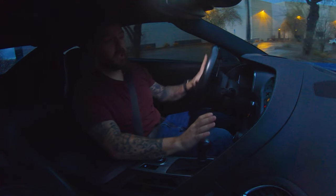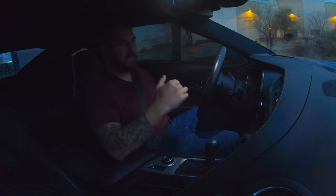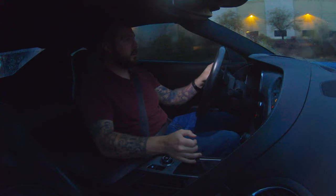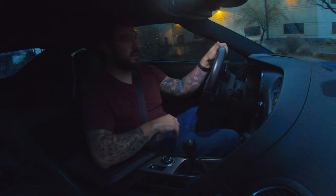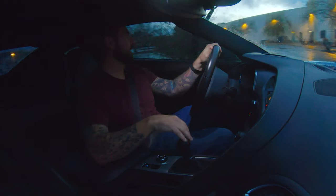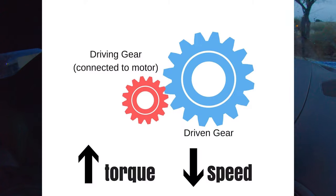The reason I'm telling you not to push the clutch all the way in is because, especially with higher horsepower rear-wheel-drive cars, first gear gets you off the line, but second gear is where all the torque's at. If you dump the clutch into second, you spin out — that's why you see people have little accidents leaving a stoplight. First gear is straight as an arrow, then second gear and they're all over the place. Second gear in a lot of cars is where the most torque happens because you have a larger gear driven by a smaller one to produce more torque.